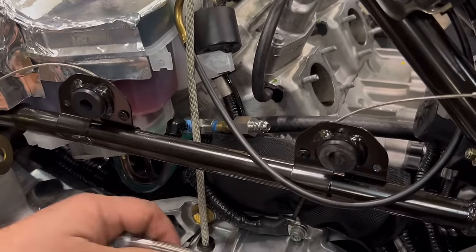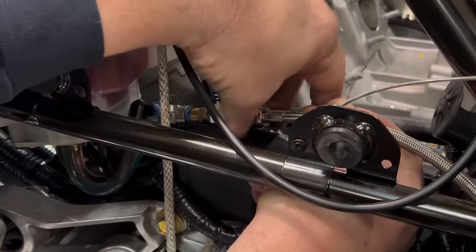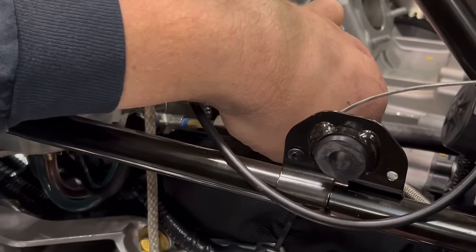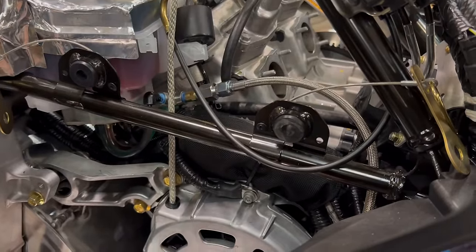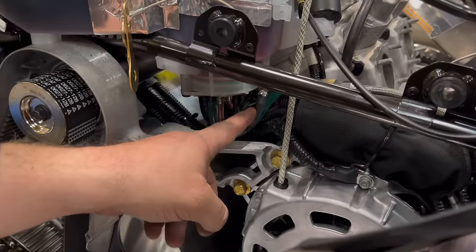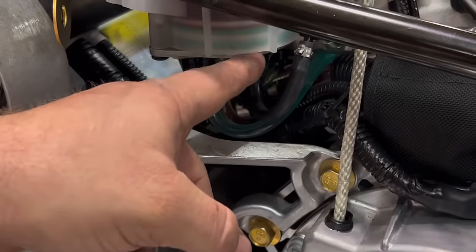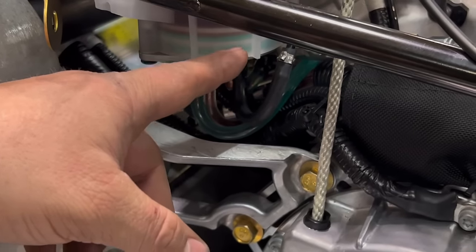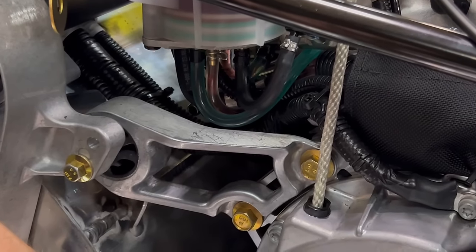We'll hook up the oil line in preparation for the turbo to be installed. When you hook this up, make sure this makes a nice loop. You may have to readjust the fittings a little bit. If you do, make sure that they remain tight enough to not leak. There is over 60 pounds of oil pressure in these lines.